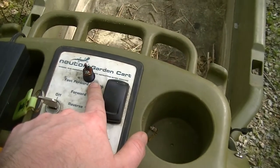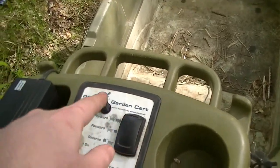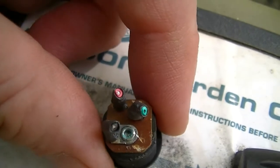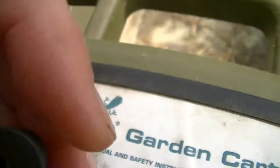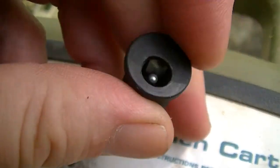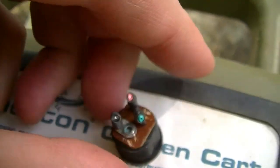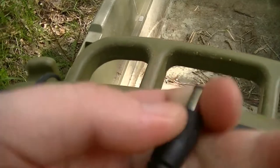The way you replace the charging connector — specifically the wiring pattern on the charging connector — is: the black wire goes to the tip, which is that little post at the center of the connector. The red wire goes to the sleeve, which is the outside of the barrel connector — the metal bit that you can see there.